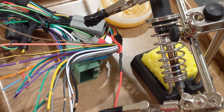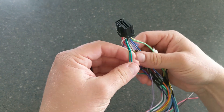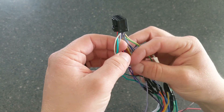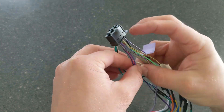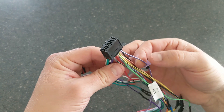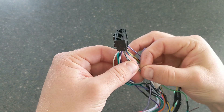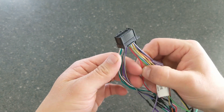So I've got my wiring harness all complete here. The dark green and black stripe — that's one of your speakers. White solid and white with a black stripe — that's also a speaker. Two dark purples, solid and one with a black stripe — that's a speaker. Don't confuse that with the purple with a white stripe, which we'll get to in a second. And our last speaker is gray — solid gray and gray with a black stripe. So already, almost half the wires are just speakers, and those are easy to figure out.